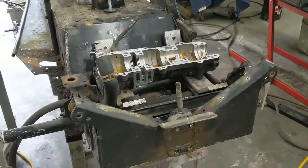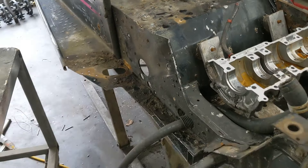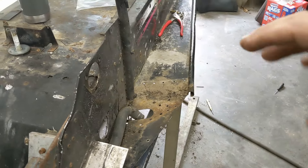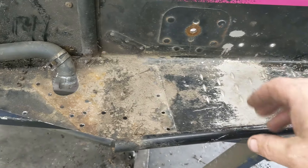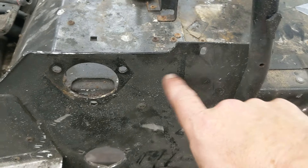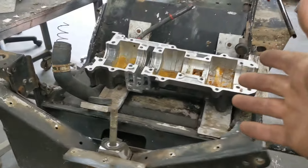Everything I did here was last night. I drilled out all my foot stirrups — drilled and ground and you name it. I took the foot stirrups off because I'm going to be doing a bunch of modifying. I took the coolers all off because I'm going to be dimple-dying my whole running board area — dimple-dying it upwards. One reason is for extra traction, and one is to take ounces of weight out of this thing everywhere. I'll drill a hole, dimple-die the whole thing because I want to — I'm not trying to save tons of weight, but I'm just going to do it.